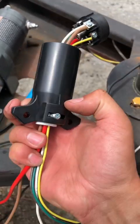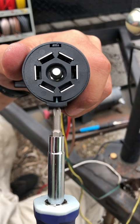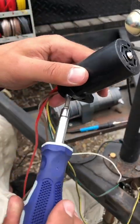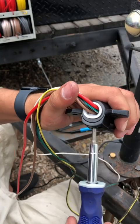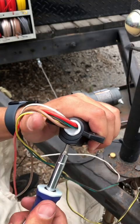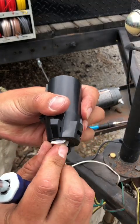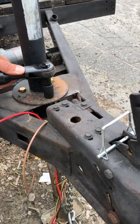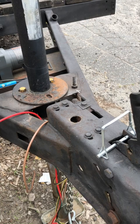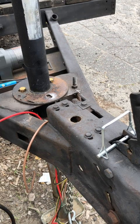You don't want to tighten it too much because if you do, it may make things oblong, and I'm not sure that's a favorable result for anybody. If you close this up a little bit, the theory is this will close that mouth and make these wires all nice and tight. Again, don't over-tighten — you're dealing with plastic and a version of plasticized rubber. This needs to be good, clean contact. Perfecto!